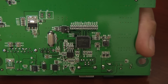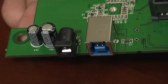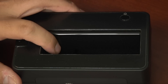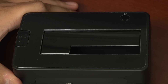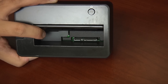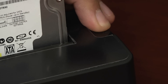The StarTech Dock uses a Lucidport chipset to bridge the USB 3.0 and SATA interfaces. The dock is compatible with SATA revisions 1, 2, and 3, though the effective transfer rate is limited to the top speed of SATA 2. The dock uses a trapdoor-style cover that folds out of the way when a 3.5-inch hard drive is inserted. A smaller slot allows 2.5-inch drives to be inserted into the same mechanism without tripping the trapdoor. In either case, the inserted drive is solid and stable in the dock until the user presses an eject button on the right side of the unit.